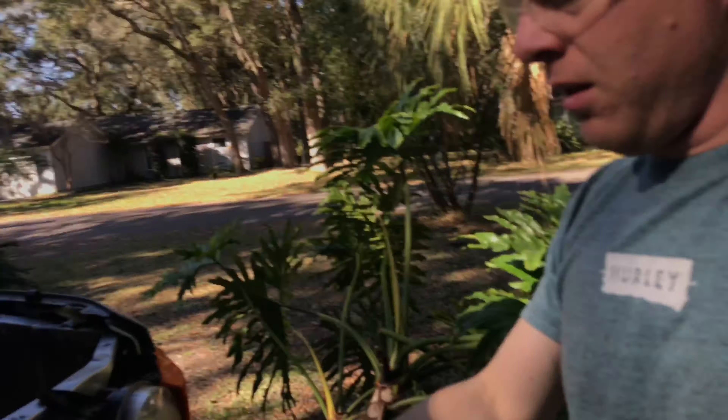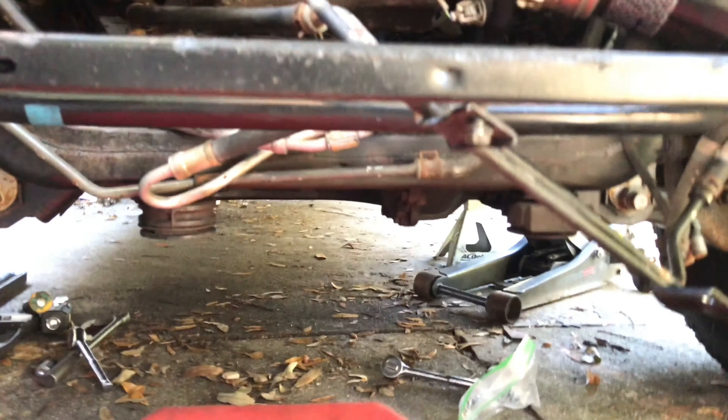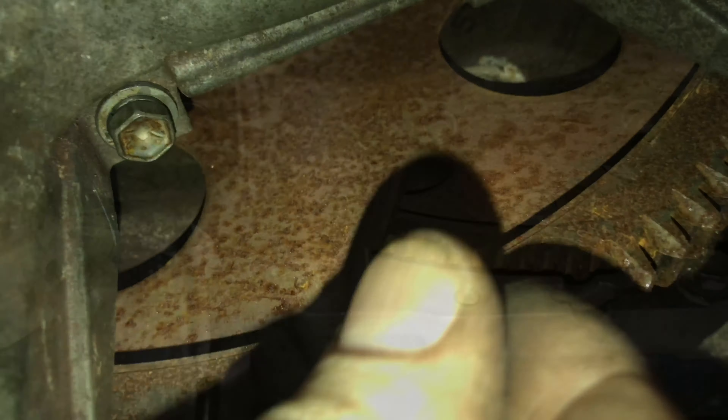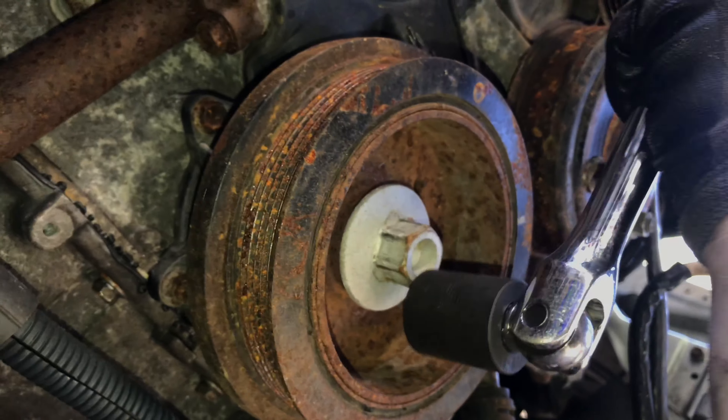Alright, it's a good day today cranking this crankshaft so that I can put the flywheel bolts in. If you've never done this before — taking off or putting on what you're attaching the flywheel to the torque converter — there's a little access plate under the car. Those line up okay, so I got that one in. I'm just doing them hand-tight until I get all of them ready. If I had a partner, they would take this off for me and put it back.